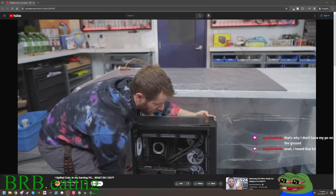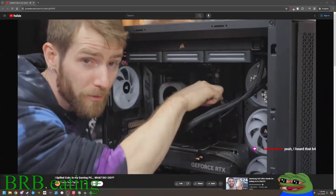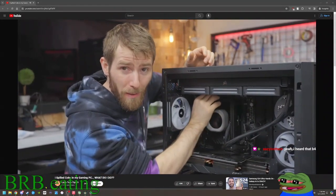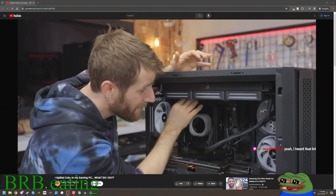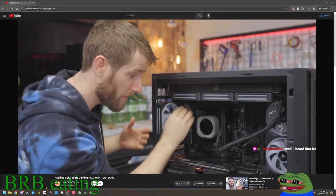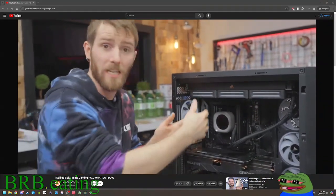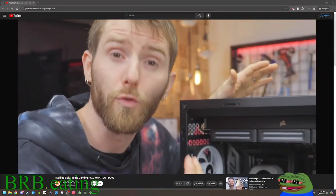Before we use any of that stuff, though, there's a couple more safety measures that we need to take. First, we need to get our power supply unplugged from any other sensitive components in the system. Remember that the capacitors in the power supply can still hold a charge even when it's not plugged into the wall, and it is imperative that no power is running through any of your components, because it's not the liquid that kills your electronics, it's the stuff dissolved in the liquid that makes it conductive and can cause a short circuit, or in the long term, can cause corrosion.